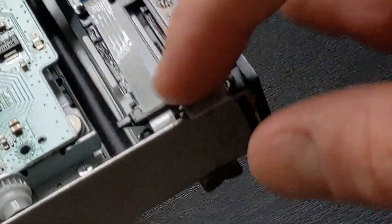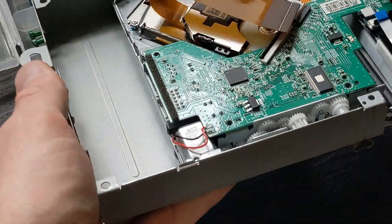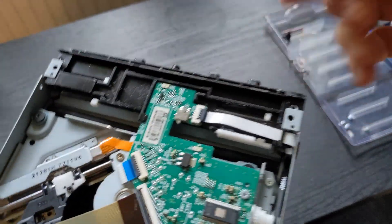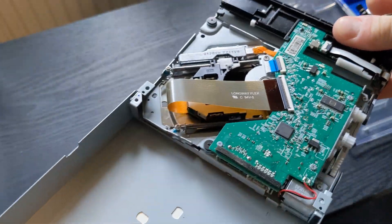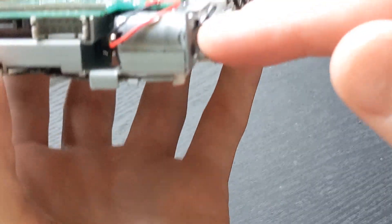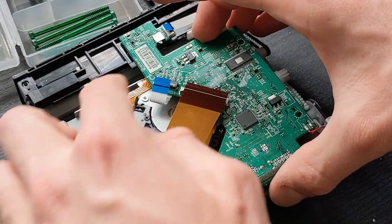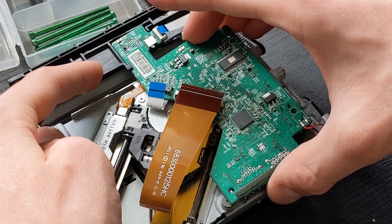Turn this over and we've got another foam pad and these clips. Undo these clips — it takes a little bit of force, but go from one side to the other slowly. The metal bit then slides out. You need to get these metal hinges over the plastic, so pull one side up and push the other side down. If you're really struggling getting these metal tabs over the plastic, you can grab a flathead screwdriver to pull it through and over — same goes for the other side. There's a plastic notch here that the motor slides under, so don't pull it straight up — slide it out first, then bring it up.